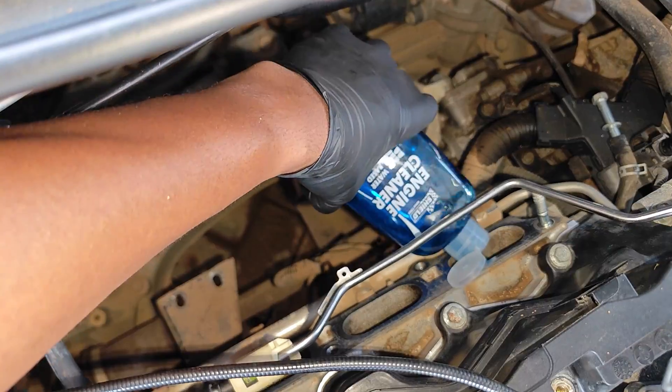You can see that most of the build-up on the valve stem is gone, but there's still some carbon here and there on the back of the intake valves. So I go back to filling up with the degreaser, left it to soak for a couple of hours, and went back to the nylon brush. For the final touch, I bring in the scotch brite pad tool that I made and did some manual scrubbing as well as some drill action.